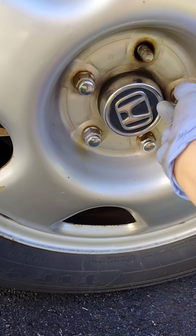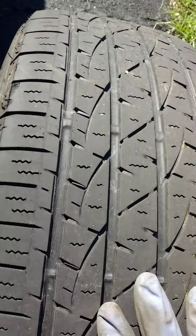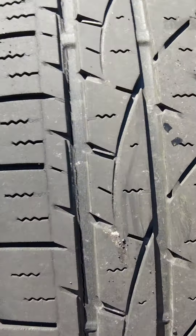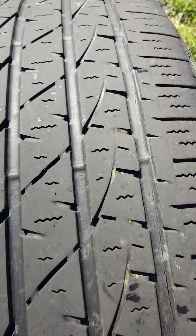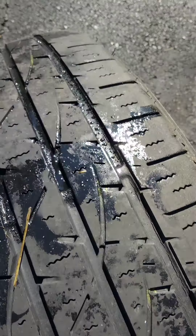Alright, so now this is the right rear wheel — I've removed all the wheels already. What we've got to do now is move the wheels to wherever they need to go. While you're removing them, the best thing to do is look at the tire and see if there's any nails in there. This is just a little rock, but keep looking through the tire — you should be able to inspect it carefully and look for nails or screws. If you have any, you'll need to see whether it's bad enough to get it patched, or if you can just reuse the tire. It looks fine here, no nails, nothing on it.